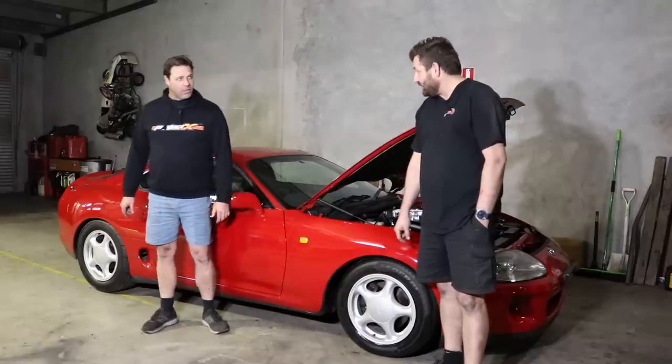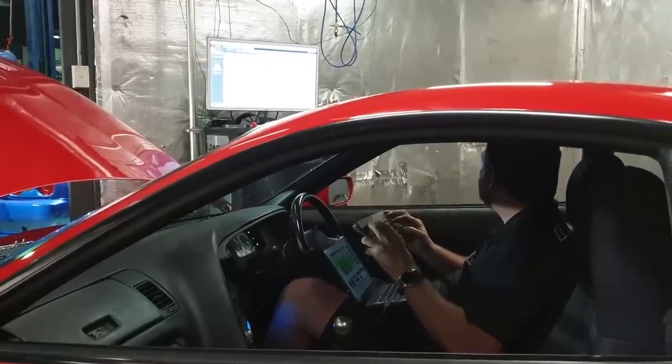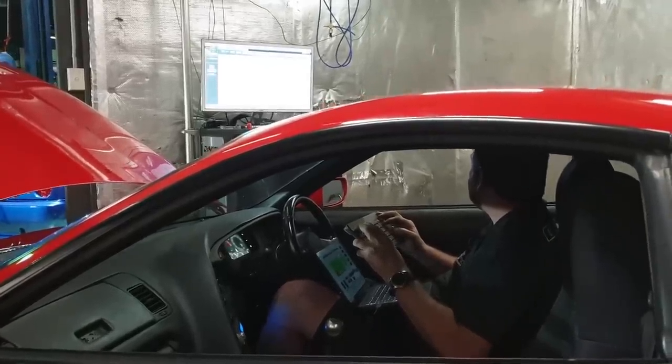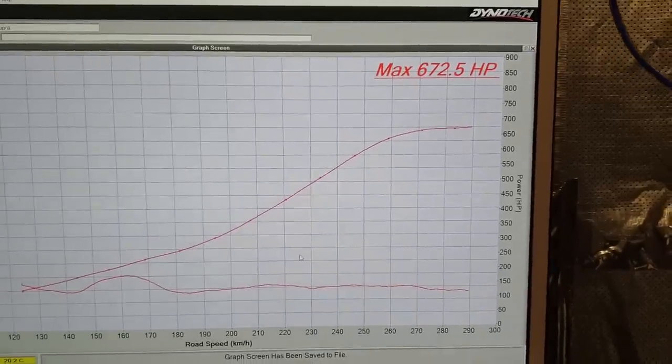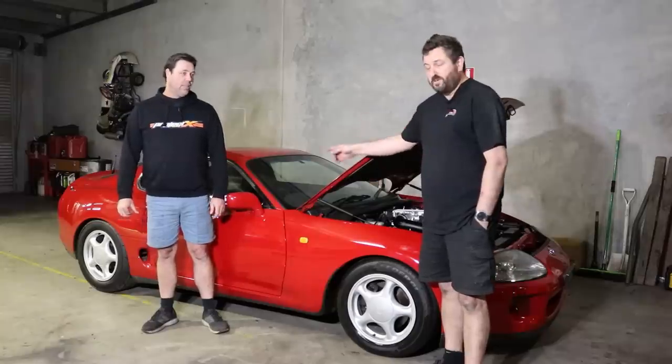Anyway. So last week we sort of ran it up on the dyno on 45% ethanol and ran out of boost control at about 16 pounds of boost. It was fairly laggy, coming on at about 6,000 revs. So since then, I've put it back up on the hoist. We've put all of the wastegate spring in it.